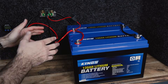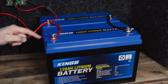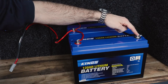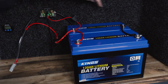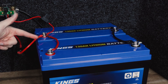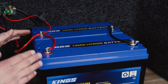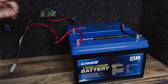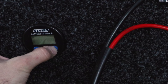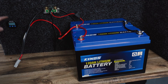Connecting a battery monitor to two batteries in parallel is much the same setup. I've got my two 120Ah lithium batteries connected in parallel — red to red and black to black. The negative wire still runs from only one battery into the shunt, and the temperature sensor is also there. The positive wire runs from the other battery, and both connect up to appliances, loads, and chargers. That way each battery does an equal amount of work, but everything passes through the shunt so it's measured. Remember to set your battery monitor to the correct capacity for the two batteries — in this case, 240Ah.